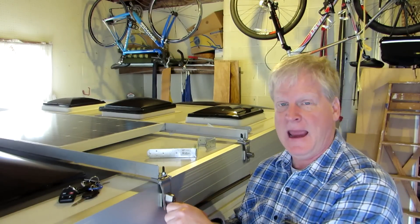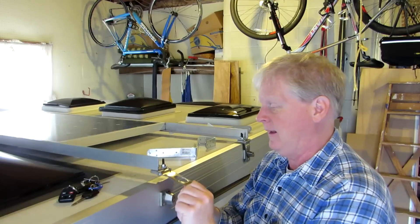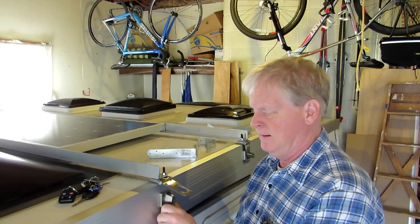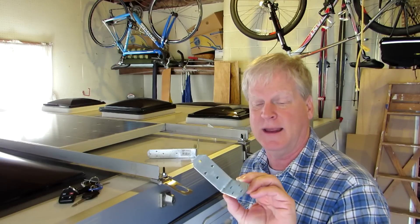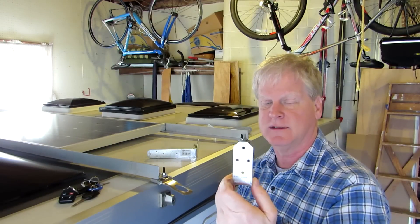When I put my solar panels on a year and a half, maybe two years ago, I used these locking hasps. I figured if I wanted to take the solar panel off I could just raise them up and it would come off, and I could point it towards the sun more. But I've decided I've never done that, never used that feature, and these are kind of a pain. They're wearing on the frame because it's right on the frame and I didn't put any kind of spacer on it. So I'm going to change it to use a regular angle bracket that you can get in any home store — the kind used for putting two-by-fours on a wall to stabilize them.